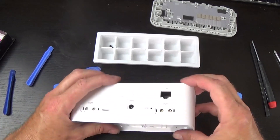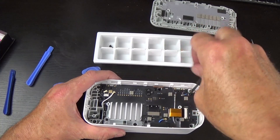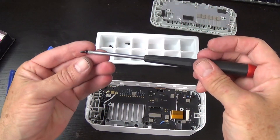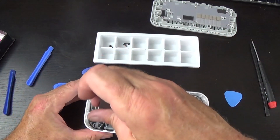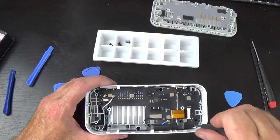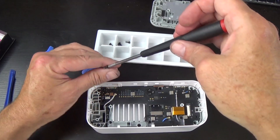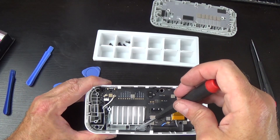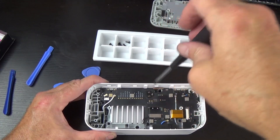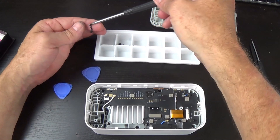Looks like I'm going to have to take out the corner screws here — these will go in my second order bins. The threading on these is different — this is plastic thread, totally different than machine thread. The first ones were machine thread. They're about the same size screw and use the same size screwdriver, so it's good to keep them separate. I see at least four, possibly five or six screws. Plastic thread or machine — you have to keep track.